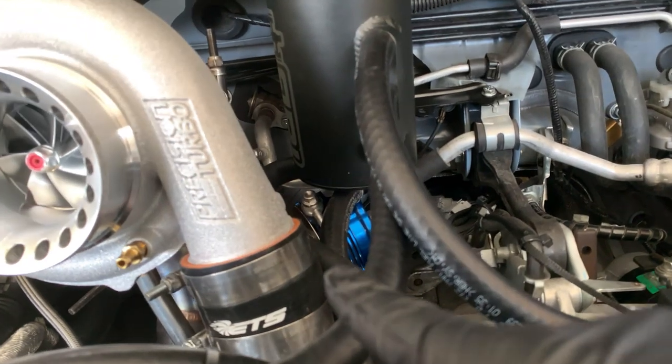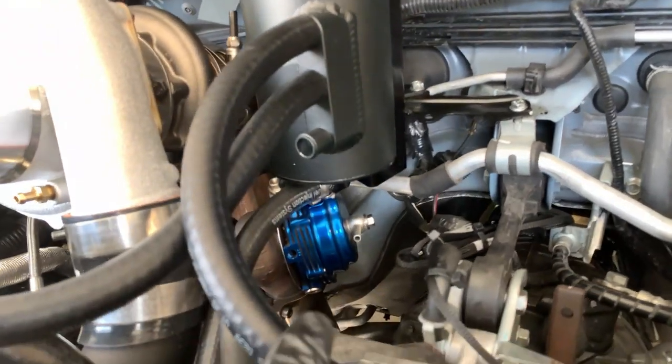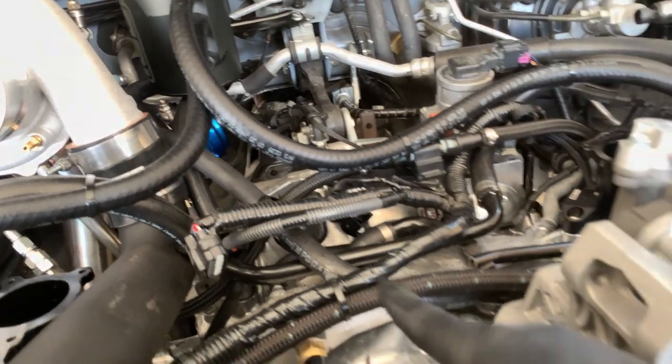I'm doing push-lock fittings on here — there will be no rubber vacuum lines anymore. They're going to be hard plastic and they just push in, super nice. This is what it looks like. As I've mentioned earlier, some people do need this repeated so they can see what's going on. We have our driver valve cover, passenger valve cover, and our bottom return that goes to the back of the block. There's also a line that comes down to the back of the block breather — mind you, this is hard to get to now. And then we have our coolant line ran up away from the wastegate so we're not near the heat there.